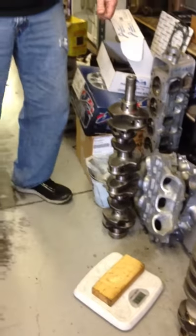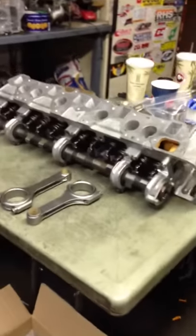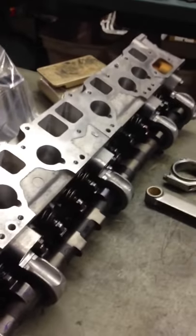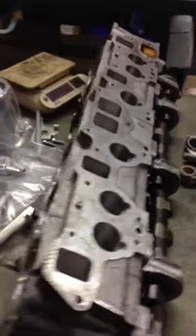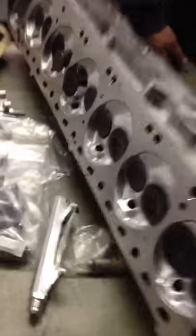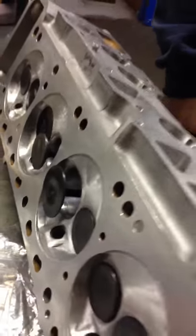Mr. David Rebello also mentioned we have a head in the back of the shop. We've had it all ported and polished and ready to go with our hot street cam, which is 570 lift and about 306 degrees duration, 264 at 50. This is the biggest cam we run on the street. It's got our Supertech stainless steel intake valves, and for street use we use an OEM 280 exhaust valve for the unleaded fuel.